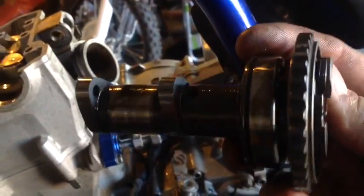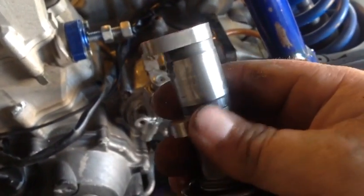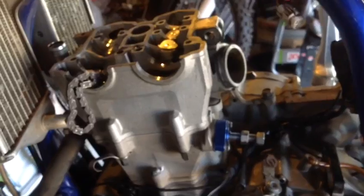And yeah, my cams, man, they look great too. Holy crap, this bike was running efficient, boy. There's like no scarring or anything weird. Black spots, just oil. But man, this thing's just killer condition. No egging on the cams. The coating's good. So I'm stoked. This motor's gonna be badass.